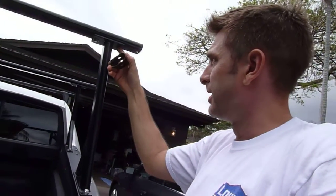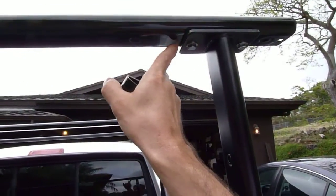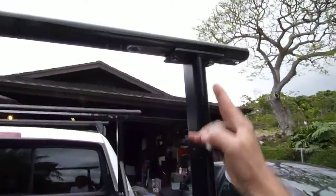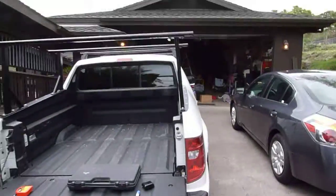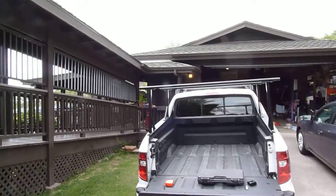So if you have bought your VanTech first generation steel rack, I highly recommend removing 1¾ inches from the rear bar and utilizing the inner holes on one side and the outer on the other side. And that'll make these plates sit flat. Originally I had to put some washers in here, and it didn't really sit well with me. And these don't line up. You can see how all the vertical bars on the rack line up perfectly now. And originally they were not doing that.